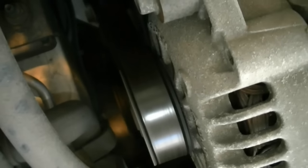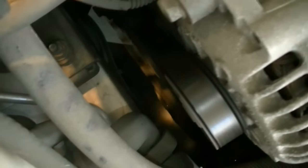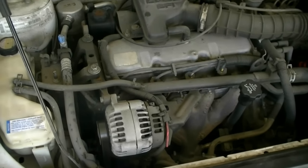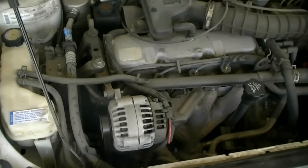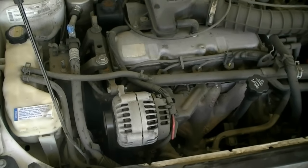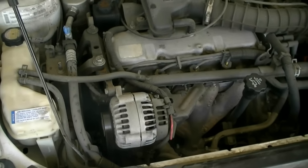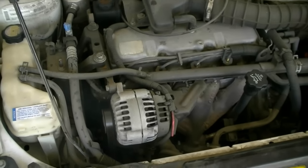Here's how it looks with the clutch engaged, and here's how it looks with the clutch not engaged. I'm going to do the rest of this video with the engine off so you can actually hear what I'm saying — but remember to keep the engine running when you add Freon. If your AC compressor clutch has engaged, you can fast forward toward the end of this video since you're almost there. If your clutch has not engaged, you'll want to do the next step.